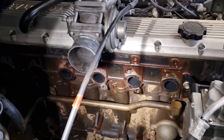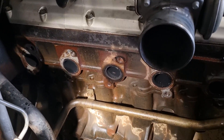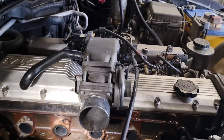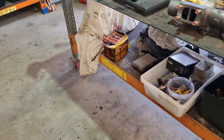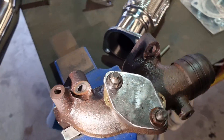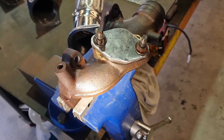The exhaust manifold came off a little bit too easy — got a snapped stud in there, which is just great. This car had an EGR block-off up there which I'll leave in place, bolt it up, and get rid of the pipe. Had to make a quick temporary little block-off on the exhaust manifold — just made it out of about 5-6mm mild steel, should hold for ages.